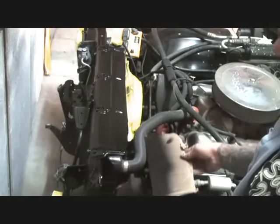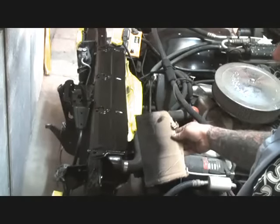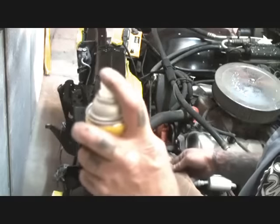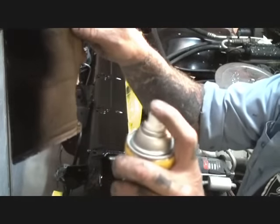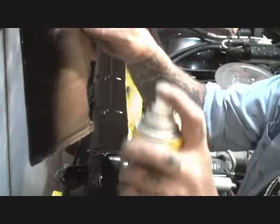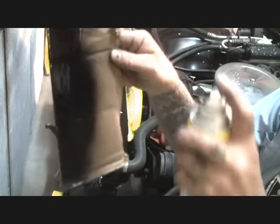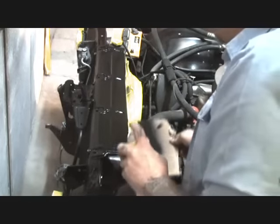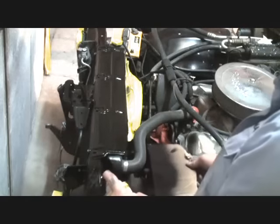I'm going to go ahead and repeat my process probably twice, put a nice good coat on that, and I'll check the front end of the car as well, and go ahead and spot paint that. This is what I call spot painting, when you just tap it like that. Do you see what I'm saying? See how I'm painting that right there? I'm just doing little spurts of paint, but I'm following and keeping the dryness. I'm taking the dry out of the paint as I'm painting it.